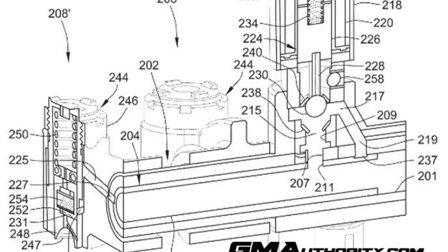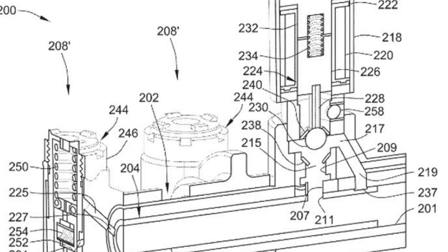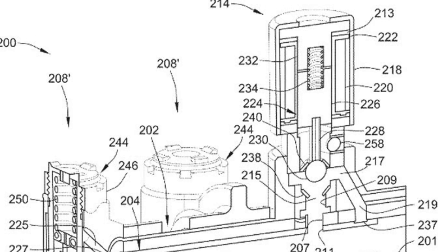At least it'll be easier to access. When the high pressure hydraulic fluid reaches the lock spring unit in the rocker arm, the unit disengages the rocker arm from the push rod. This sounds like it's going to be a nightmare. This prevents activation from the push rod to the rocker arm, effectively stopping the intake or exhaust valve from opening — the cylinder is essentially deactivated. So hydraulically we're now shutting down the rocker arm, which shuts down the ability to open and close the valves. It seems like they moved the problem from internal to external, which is fine by me. At least make it easy for us — maybe we can just take the whole thing out and put normal rocker arms on.